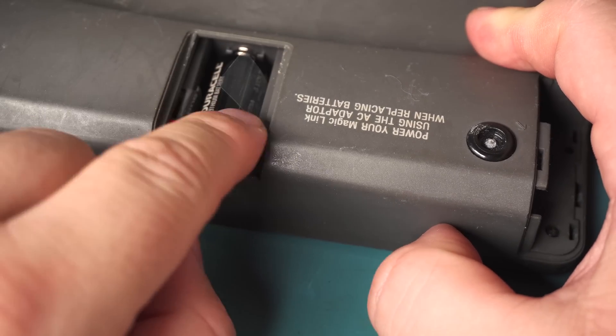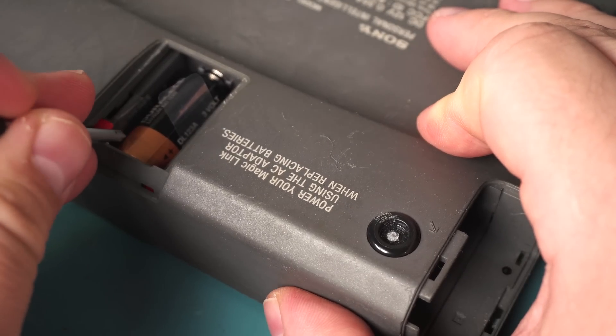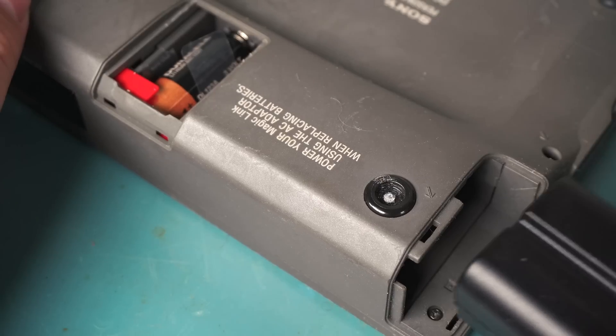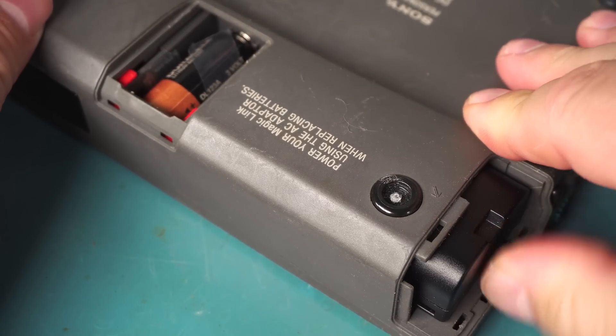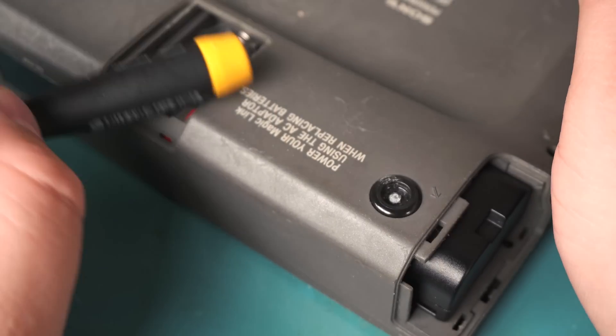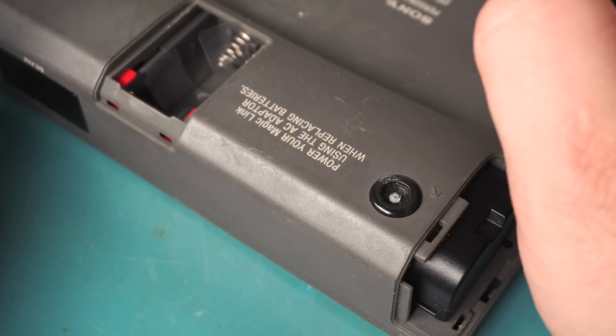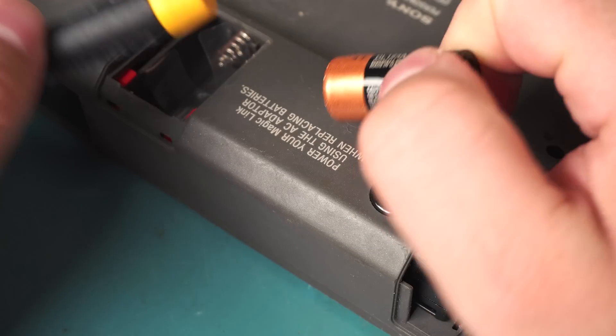The unit has a backup battery with a nice little red retention system to protect the internal memory. When you insert a standard battery it moves it out of the way so you can replace the 3-volt lithium battery without wiping the internal memory, because it's SRAM not flash — without power it just dies.